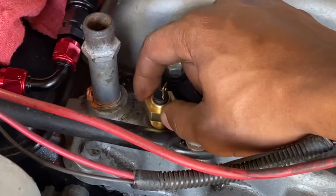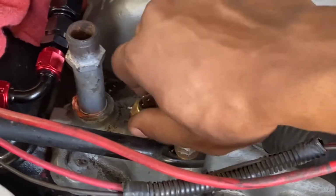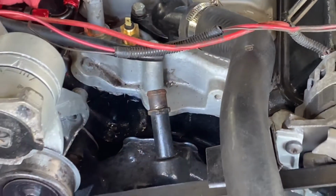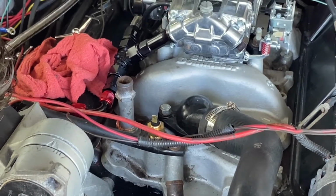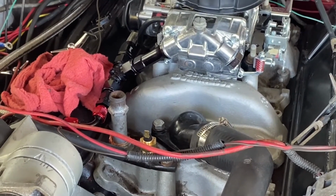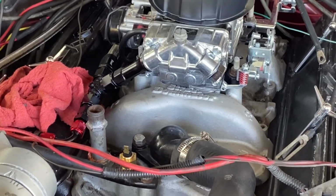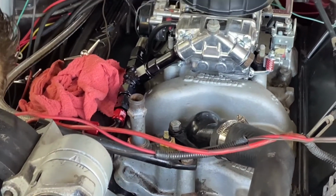So it'll screw in slightly like this. And when it gets to where it's about to tighten up, and then you turn it at the last turn, it releases because it doesn't have anything to bite onto. So unfortunately, we have to tap that thread with what, like a 1/2 inch tap? Yeah, a thread chaser. We can bring the threads back, so it's not a catastrophic issue.